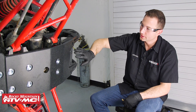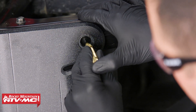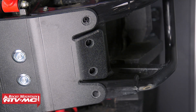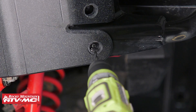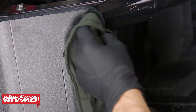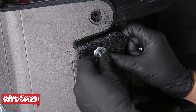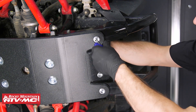The next step is to install the front bolts into the front skid. To do that, we're going to drill some holes using an auto-centering punch. Now that we have our drilling locations marked and punched, we'll use the provided drill bit and drill these out, using a little bit of penetrating oil on the drill bit. Clean away the metal shavings. Next, install Hardware Group B: the aluminum cup washer, the M6 by 20 button head bolt, and an M6 flange nut that goes on the back. Once all those are installed, go ahead and tighten them down.